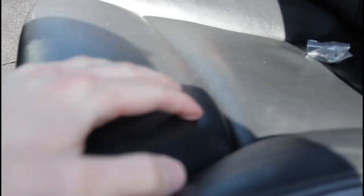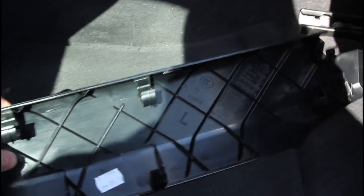In order to remove the assembly you will have to remove a couple of plastic trim pieces — this one down here, this one right here, and then the plastic piece right up here. They're all held in by a couple of tabs. For the bottom plastic piece, all you want to do is pull straight out. As you can see it removes, and what it's holding on are these tabs right over here, which clip into this metal pole right here.